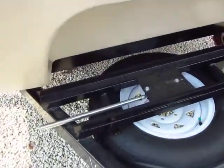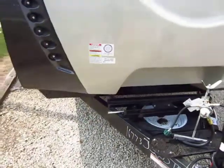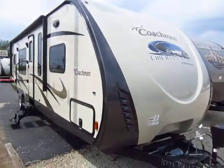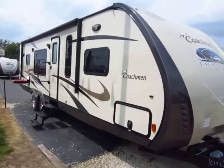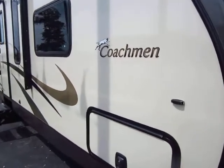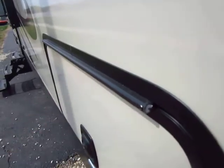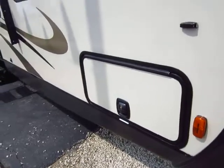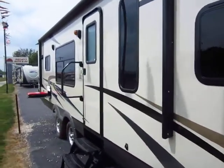On a Freedom Express you have a double-size battery rack. You can put two batteries on here for double the dry camping time. Some folks like to put a pair of six-volt batteries on here for a very large reserve. This is Coachman's top-end lightweight unit, so you're going to see nicer upgrades and features — like how they enclose the piano hinge on the baggage door, and notice that's a slam latch door, not a twist lock door.